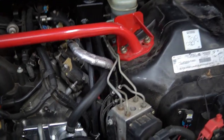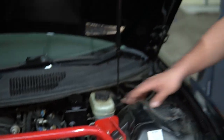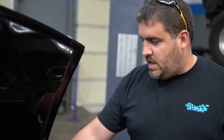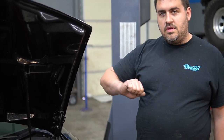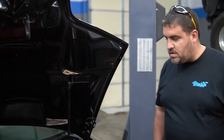Now that we've got our belt back on, triple-checked everything — all clamps are good and tight, belt is on, hoses are routed out of the way — we're going to fill it with fluid. When priming, you really want it off the ground. Typically what I do: start the car, let it run for just a second and it'll suck fluid down, then top it back off. Then with it off the ground and no pressure on the wheels, ease the steering back and forth a little more each way to work the air through without burning up the pump.